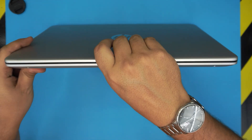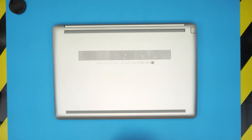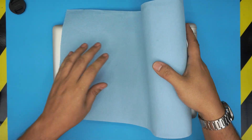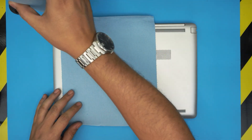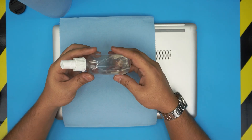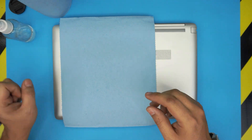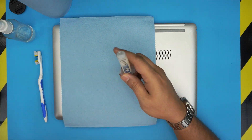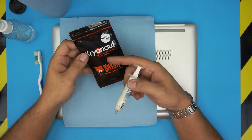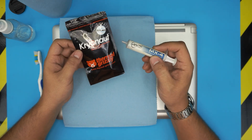I'm going to go over the tools I'll be using and I'll leave the links in the video description so you can purchase yours. Tool number one is a workshop towel — just one sheet. You need isopropyl alcohol, 95% or higher — make sure it's 95% plus. You need a toothbrush, used or new, and you need a good thermal paste. I'll be using Arctic MX4. You can also go with Thermal Grizzly Kryonaut — it's a high-end brand and expensive, but I still recommend MX4 or MX5.